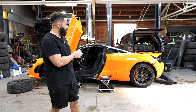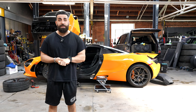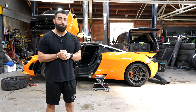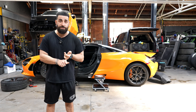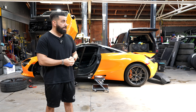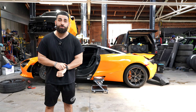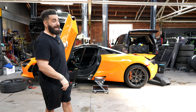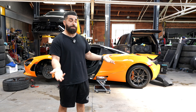We see this type of stuff often — this is a McLaren 720 purchased from the East Coast somewhere. The customer got the car and it had a bunch of issues. McLarens have issues as it is, but this one looks like it's been in an accident or two. We see body repairs, the hood's been repaired and painted, a lot of things in the back don't match up. The car was having battery drain issues, multiple errors on the dash, and it actually died right when the customer dropped it off. We had it on rolling jacks because we couldn't start it — his key fob didn't include the manual key so we couldn't open the hood. We did some tricks to open it, changed the battery, took the door panel out, and saw wiring was all spliced and cut — probably from an accident. We're fixing all that, and the customer is going to gladly take it back.